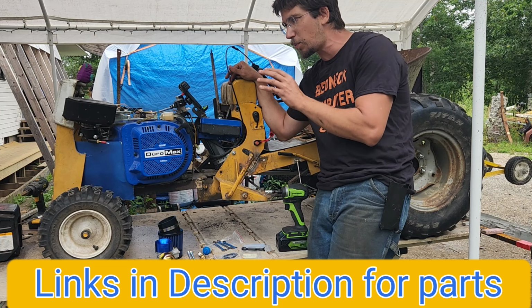So the statement was that if I got one of these racing intakes, I'm going to have a cutout in it that's going to match up with that idle jet right there. And it's going to go through, and I'm going to pull air at idle, and the world is going to be happy again, and we'll be able to idle this thing at the starting line. That said, let's rip off my homemade intake. Let's throw this intake on and see what it does.